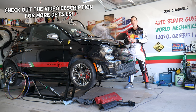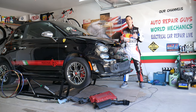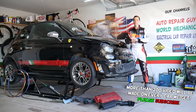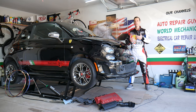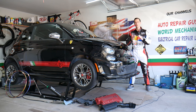It could be any engine, practically diesel or gasoline. If you have a problem where you replaced your crankshaft position sensor with a new one and the car still does not start, or if it starts it runs really rough — you may even get the check engine light on with a code such as a correlation error: camshaft and crankshaft position sensor does not match. Stay with us, we'll explain how to fix that and what causes it.